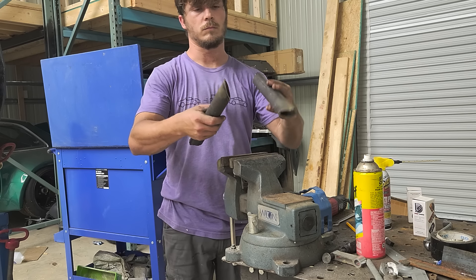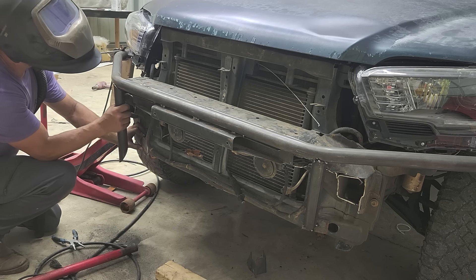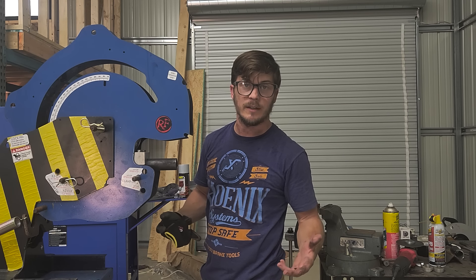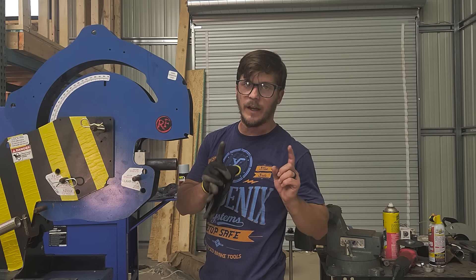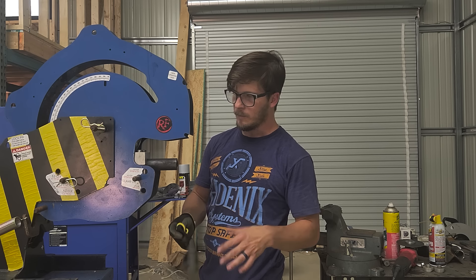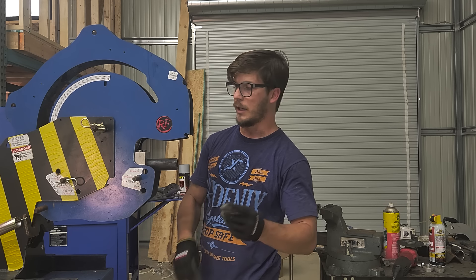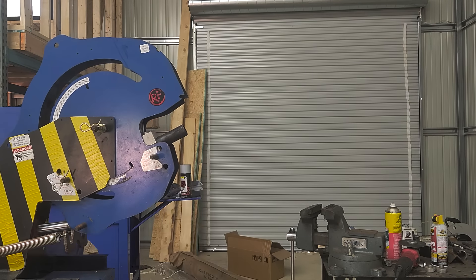I have all the tools and I very much enjoy building stuff out of tube, but I'm not very good at it — I've had a little practice. What I've got to build is the final piece of tubing: the lower triangles. I already did one — spoiler alert, it went poorly. I think I can salvage it but the welding is going to be difficult. I'm going to try again. I've got a piece of tube about two feet long, I'm going to put a 25-degree angle in it, then I'll show you the problem.